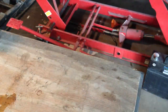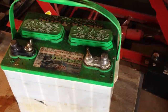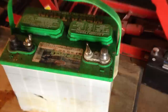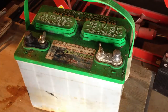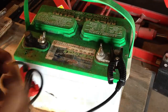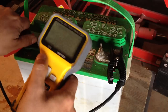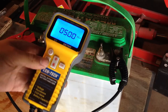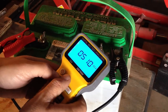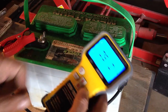That's a heavy battery. And then we've got this one — it had a weak cell, possibly just a completely dead cell. Immediately after putting the Epsom salt mixture into the battery, it tested higher right away. So let's get the correct cold cranking amp rating in there: 550.